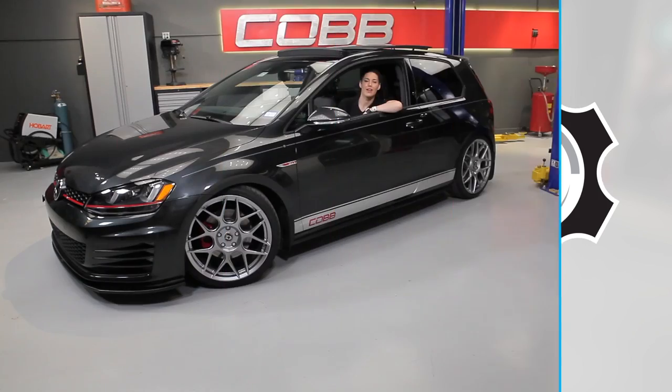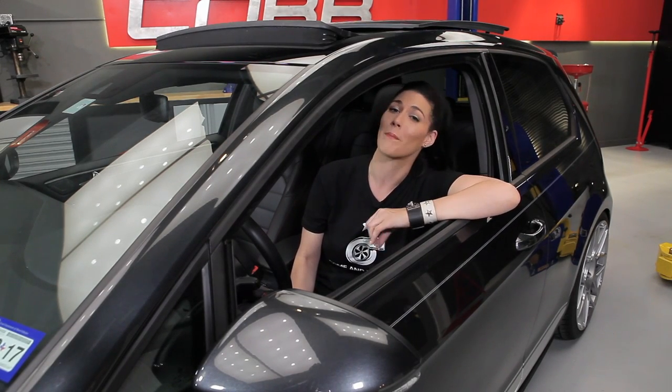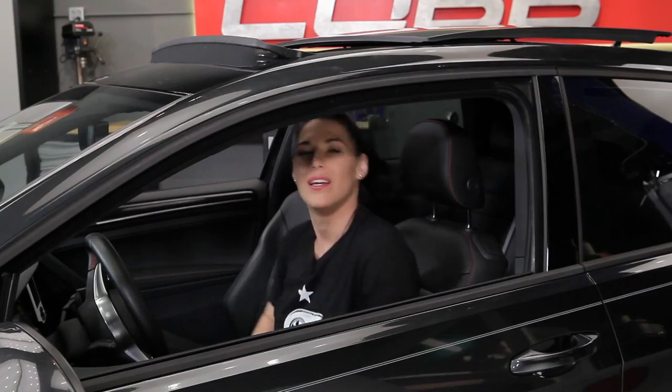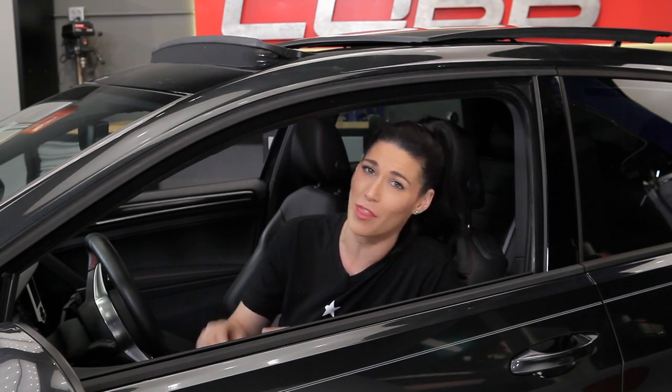And now it's time for the pro tip of the day. Today's pro tip is going to be clearing up a major misconception. We've talked about the various sensors within the engine and how they work together with the ECU to control the engine. One of the jobs of the ECU is to make adjustments and compensations for certain variables that occur while driving based on sensor feedback — for example, changes in temperature, inconsistent fuel quality, or things like minor air leaks. The condition your car lives in isn't going to be perfect throughout its entire life, and the engineers that designed your car know this. The misconception is that because of the ECU's ability to adapt, the ECU will tune your car for you when you modify it. We've literally had people call and say that someone told them it was okay to add a part without retuning because their car's computer will figure it out for them.